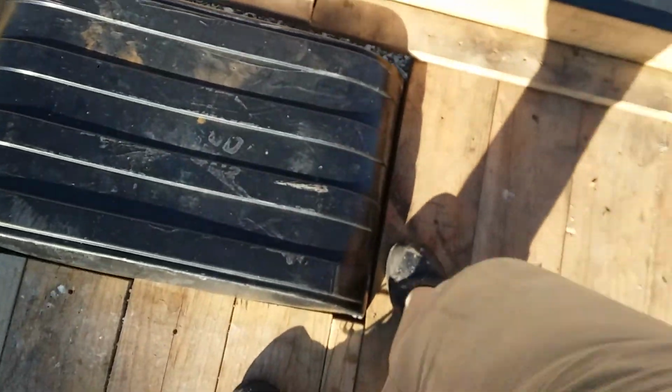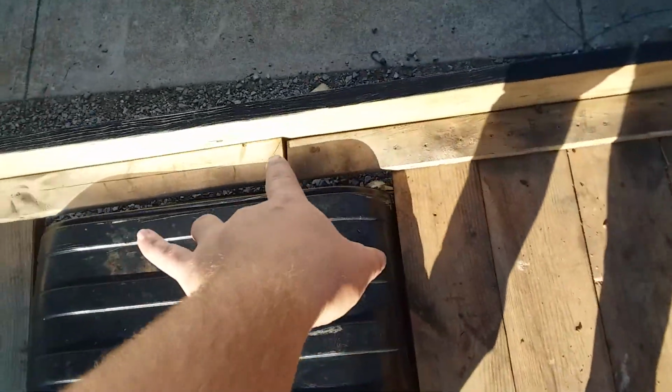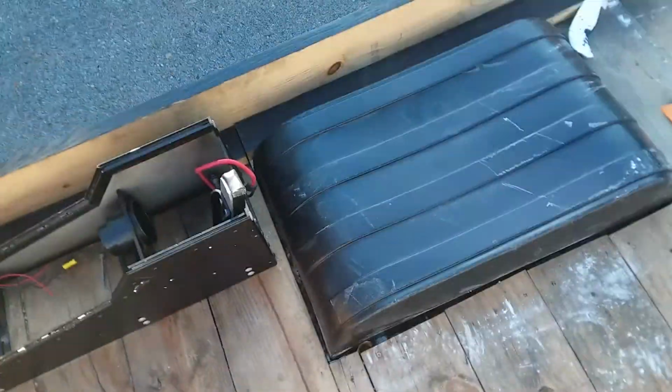We'll get some jacks, some off-road jacks to lift it up. We'll put 2x6s on the frame all the way back where you can see all those screw holes. We'll do 2x6s, oh excuse me, 6x6s, just like the box trucks have. That'll bring this up about probably an inch or so over these fender wells, at which point we'll bolt the bed back down, take these apart, and go ahead and get one continuous 2x4 to redo this, so that you don't have that lift like you do there and the split like you do there, because we didn't have a piece that was that long.